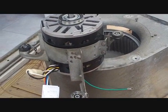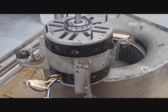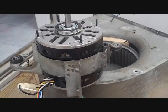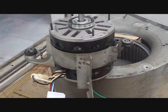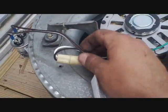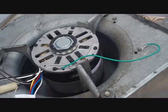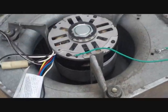Next we're going to install the old harness onto the new blower motor, making sure to use the little ventilation holes as a guide so it's nice and even, because you don't want the motor cocked at an odd angle — that means the shaft will be cocked and the blower will go all to hell. Measure it if needed but the holes on there usually keep it pretty straight. We got the motor in there, tightened up to three-eighths, got the ground hooked up to the chassis, the reversing plug in, and we'll use tie straps. Got the capacitor hooked up — 5 µF Mars capacitor. I'm keeping the specific rating I need and saving the other one for a rainy day.